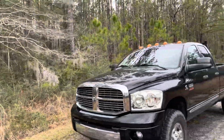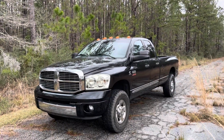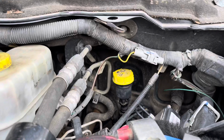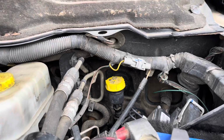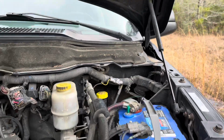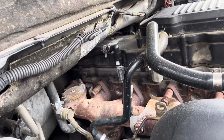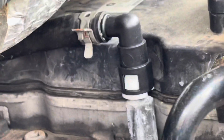I think the truck accounted for about 35% of my miles this year, which was up from like 25% last year. Complaints. Repairs. Losing some brake fluid out of our clutch reservoir. Having to top it off every 3 to 4 months. That's fine, minor inconvenience, but if you're not paying attention, your clutch pedal may get spongy. Just doing that to hold off till I get a new clutch setup, which is in the works, hopefully later this year.